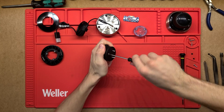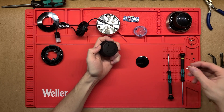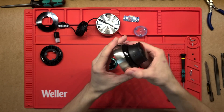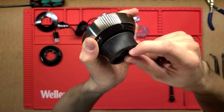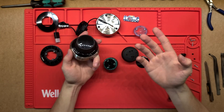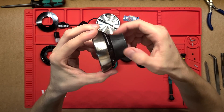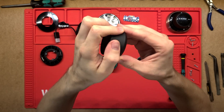I've just popped that plate off and I'm undoing these three screws that hold the sensing array together. This outer shell — on this older one, after a few years you can see it gets a little bit scratchy and rubbery and sticky — it is a rubber finish so it gets sticky. If yours is like this, you could probably just buy an aftermarket or original replacement piece and swap it out — this one is going to need that because it's getting really annoyingly sticky. On a brand new one there's no issue at all.